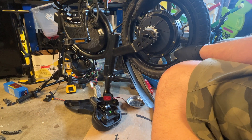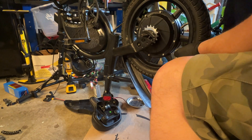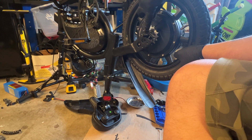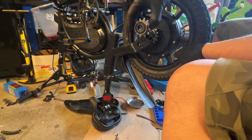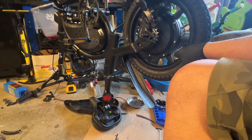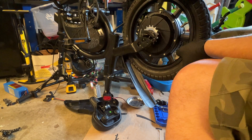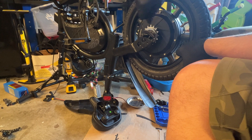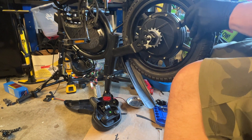When I was trying to put the stock freewheel on, it basically went past the dropout so I had to stretch the dropout to get it to fit. But then I realized it was rubbing — the freewheel was rubbing against here — and there was basically nothing I could do, so that's when I ended up going with the 16-tooth. Now that I've stretched the dropout, I'm going to have to close it back up when I tighten it all back down.